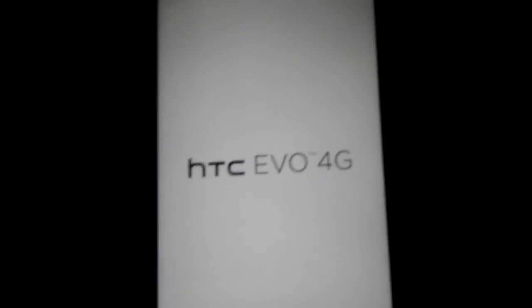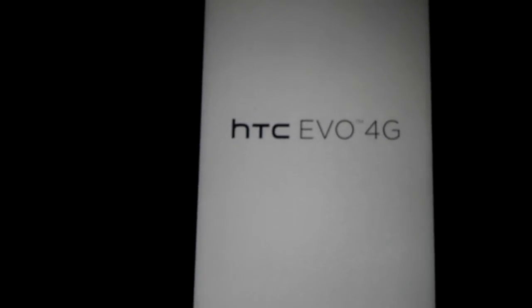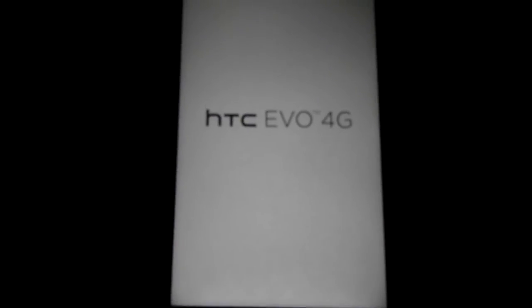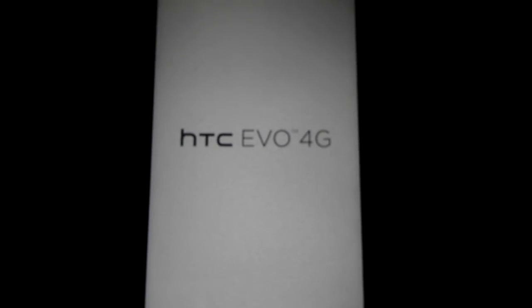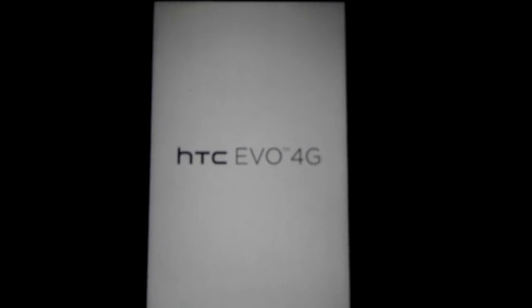Once it finishes powering off, it'll come back on all by itself, and you'll be on whatever ROM you're on. Go back into your Google account, set all that stuff up, and you're good to go. The first boot will take longer, but after you've booted the phone up, after you installed the different ROM, it will speed up if you have to reboot the phone or if the battery dies and you got to restart it.